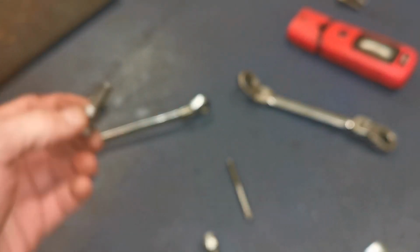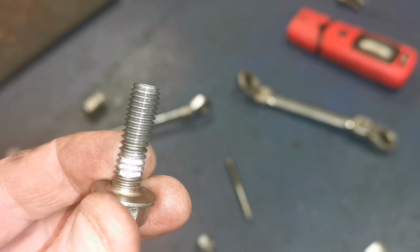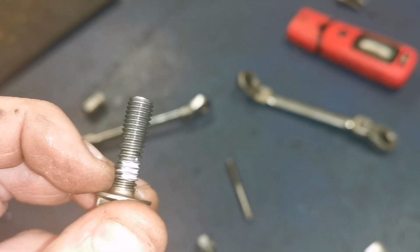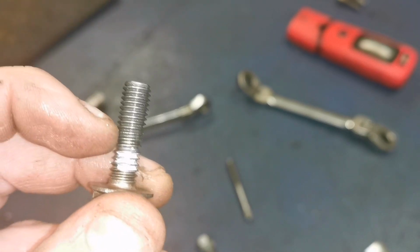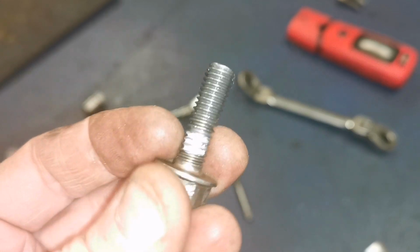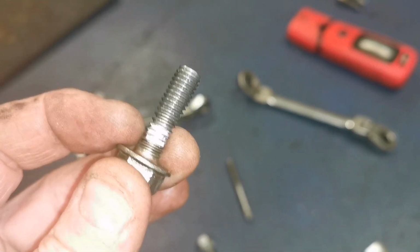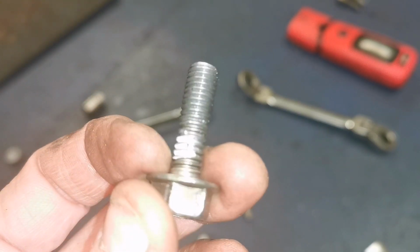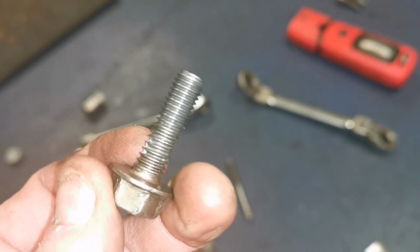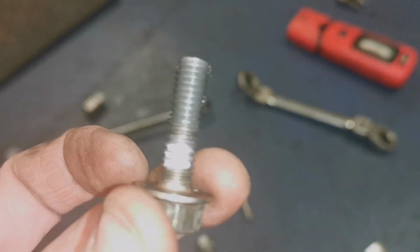And as a double check, our wee bolt with white paint that we did earlier on goes right up in that, to make sure that the threaded hole in the head will accept one of these bolts the full length, and it'll take torque to make a seal on the headers there.